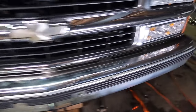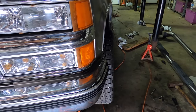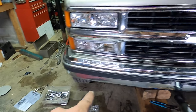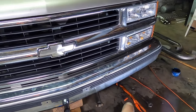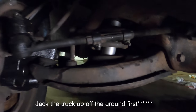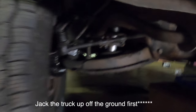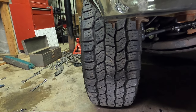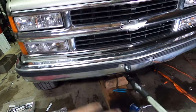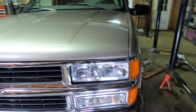Got it adjusted — looking so much better. I ended up pushing this side out nine full turns and this side five full turns. I actually did ten and six, and that's what looked right when I let it all the way down — it was a little too much. But all you do is undo the two bolts and that whole thing spins, pushing in or out — super easy. This way we're not going to have a miserable drive to get it aligned and it will actually be drivable. You can really eyeball it pretty well; there are ways you can measure it too, you can look that up if you want.